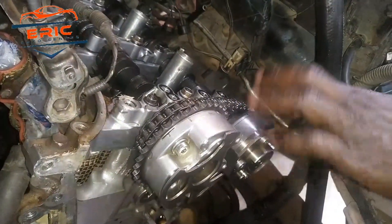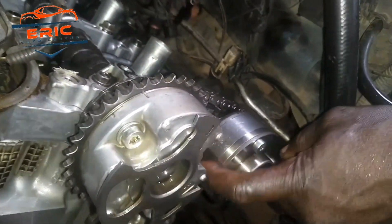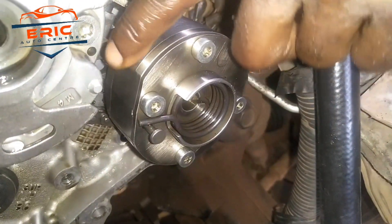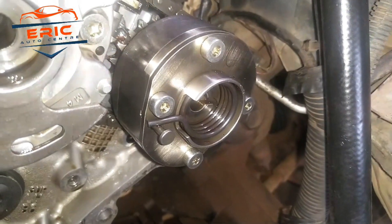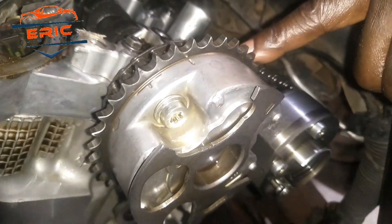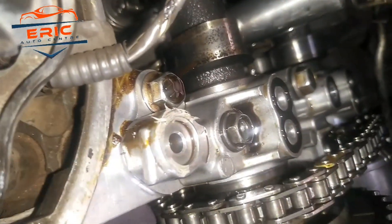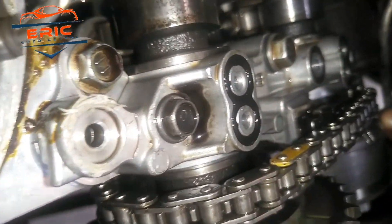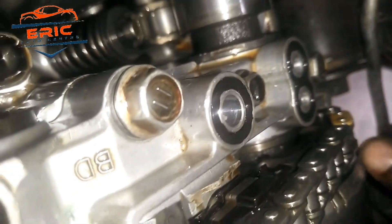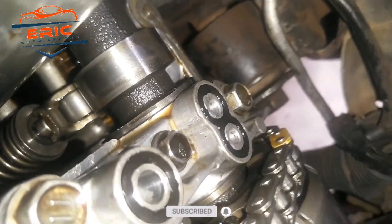When you lock it, you can see this flat side — this side should indicate correctly so that the chain tunnel allows the chain to pass through to fix it. And that is how you do it. As indicated, you see the yellow mark — the yellow mark is facing here, and here too. The single mark is also facing this particular point, which is the right key for you to use. And that's how it is. Same thing at bank two.